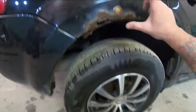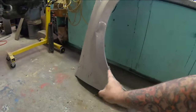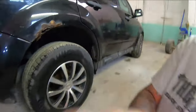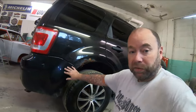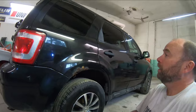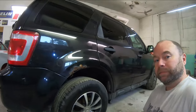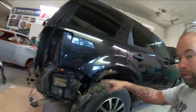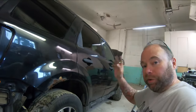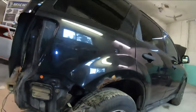So what we're gonna be doing is cutting this section out of the quarter panel, cutting a section out of that fender, making it fit. We're probably gonna have to box in the end down here. I'm gonna start tearing this thing down a bit — pull the rear bumper cover off, pull the tail light out, just get ready, unhook the battery, and probably pull some interior trim off. And then we'll have another look. Batteries unhooked. Always make sure you do that before doing any kind of welding.